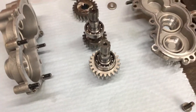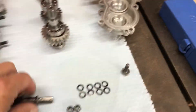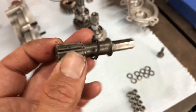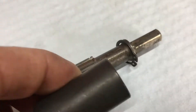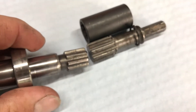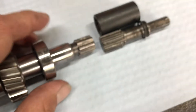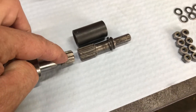The main problem we have with these pumps is the sleeve that drives the oil pump itself. Coming out of the rear of your timing case, you'll have your little intermediate shaft, drive shaft here. To get the oil pump off, you'll slide this circlip here out of its groove and up there. This sleeve will then be allowed to slide up, and your oil pump drive will be able to come back to allow you to get the oil pump off. Sean's pump, like many we see, the drive sleeve is rusted onto here.